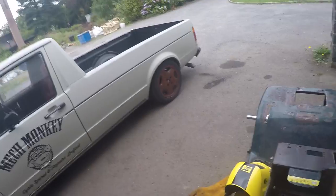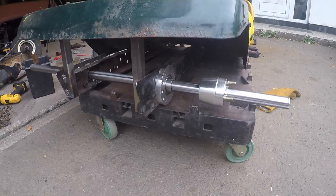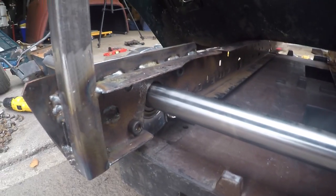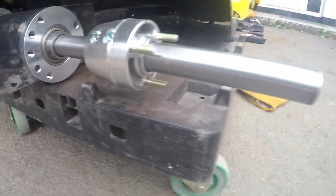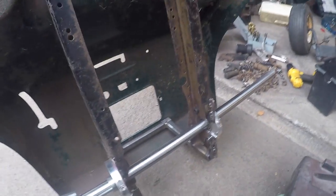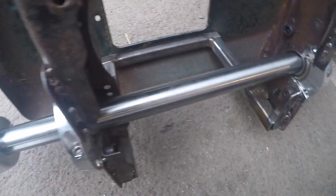She's sitting with the back axle on it. Got the back axle in place on both sides with the bearing mounts — they're just dummied in with two bolts. The axle needs a small spacer between the bearing housing and the flange just to let the bearing move a bit easier. Here it is on its end — the two rails just put back in place, starting to weld this structure in the back to support the upper bodywork. That's the first element in.